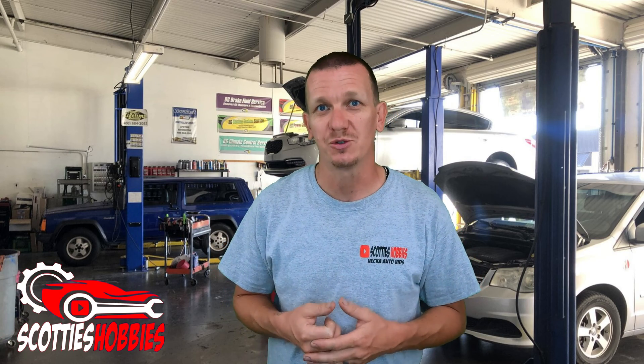So, if this was my vehicle — to sum it up — if I had these codes and I had continuity at the connector, I would slap on an Oxygen Sensor, turn the check engine light off, and go drive it for about 70 to 100 miles and pray that it stays off. If it does come back on, then I would assume we're going to have a wiring issue somewhere. With this case, you have a circuit malfunction on the heater and a circuit malfunction on the sensor part itself, so I would highly think that the Oxygen Sensor itself has gone bad.